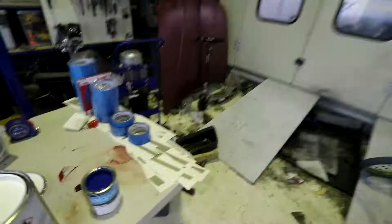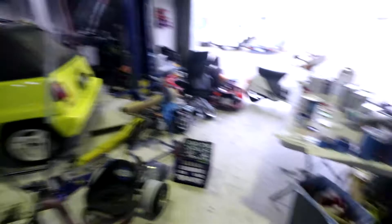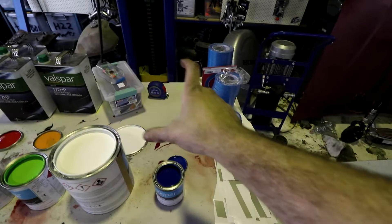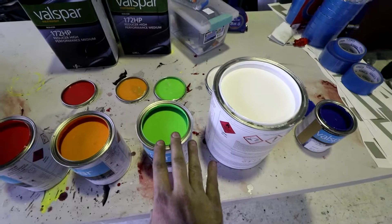I'll run over the plan. I've vinyl cut these pieces for the blue zigzags, and all the white dividers will be normal tape using fine line tape. I've got a front guard that I'll be testing each tape pull on before I do it on the car. The plan is: start with the blue, spray the rough area that has to be blue, apply the vinyl zigzag, then spray the whole car white, then mask off areas — except where I want green, do the green, mask off again for orange, mask off again for red.